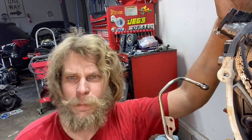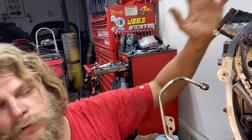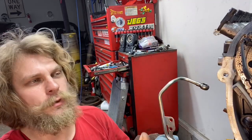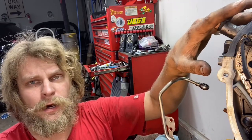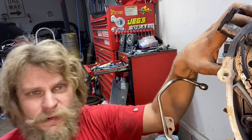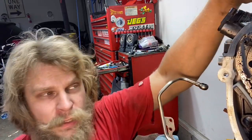Now let me cover a few different scenarios. If it's a tow-in, it's a possibility that it just barely tagged the valves — it's really difficult to tell sometimes. It's possible it may have snagged one or two cylinders just enough to make it barely run wrong. First off, if you say let's do a timing chain first to get it back in time, after it's fixed you should no longer have a timing fault — verify that it's in time. If nothing else, just verify it manually with the quarter drive extension on the crank, and then it should verify on the top cam marks.